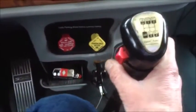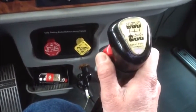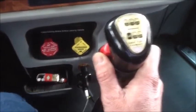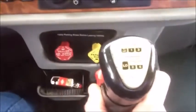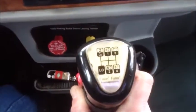As soon as you go ahead and shift into five low, go ahead and push that forward. Remember, that's pre-selecting our range. So now we're in five low. We've got our foot on the gas. We've pushed that forward to go into five high. All you do is let off the gas and it's going to shift automatically for you when you step back on the gas. Now you're in five high.